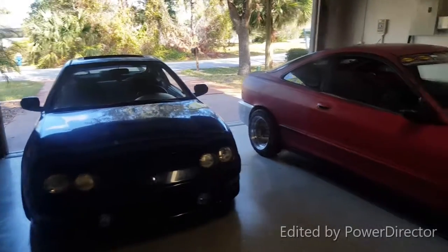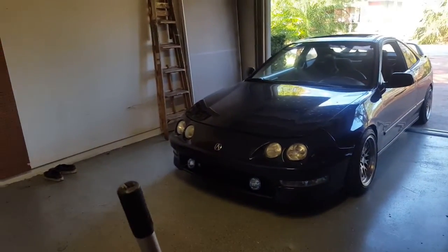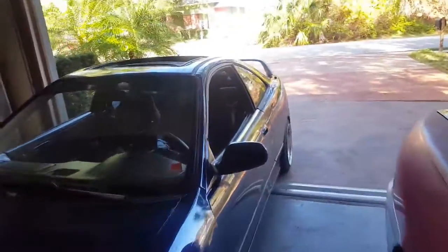Hey guys, we're back with another video, and per your request, we're going to be doing an oil change on a 99 Acura Integra, which is our automatic car. First steps first, pull it into a secure, safe location, in our case, our garage. Then you're going to want to pull your emergency brake up, or parking brake. Then go ahead and open your hood.